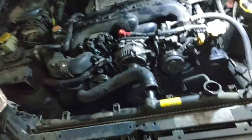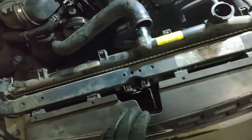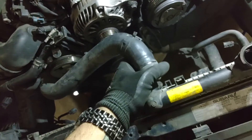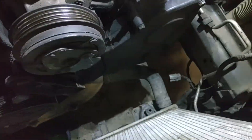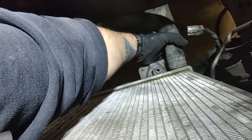Just a reminder: I'm also taking out the little hood latch connector assembly since it'll be in my way for the timing belt — again, not needed if you're just doing the radiator and fans. Both radiator mounts are now out. Use pliers or channel locks to slide the hose clamp back on the upper hose, loosen it up, and pull it free. By now there shouldn't be much coolant left in this part of the system. Do the same for the lower hose — it also has a clamp. Wait to undo the bottom hose until the radiator is basically completely drained, otherwise it will dump coolant on you.